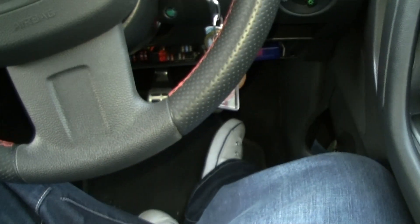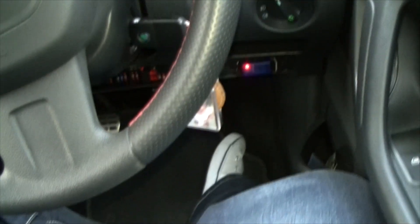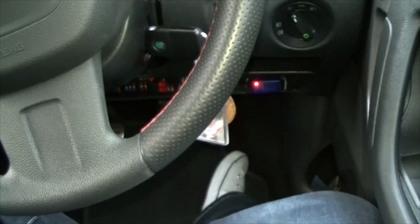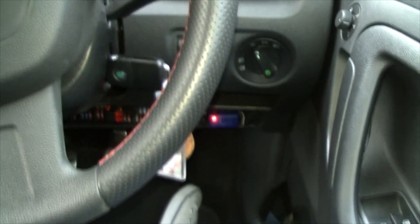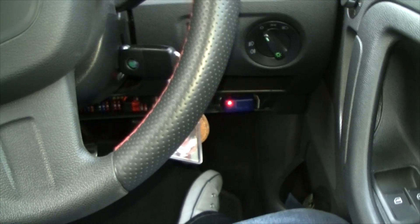Here's how to do it. First, you need to find your OBD2 port — mine is in the fuse box. I've already taken the panel off the front of the fuse box, and I'm just going to plug it in like that. You need to make sure you plug it in the right way up. When you plug it in, it'll light up. Make sure you have the engine on as well — that really does help. It reads data from the engine, but it doesn't read a lot unless the engine is actually on. You need the key on — either to turn the electrics on or to have the engine running. Having the engine on releases all the sensors for you to read from, for things like RPM, fuel, air mixture, and air temperatures.